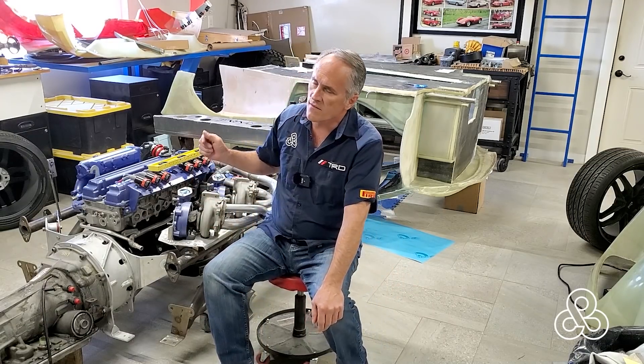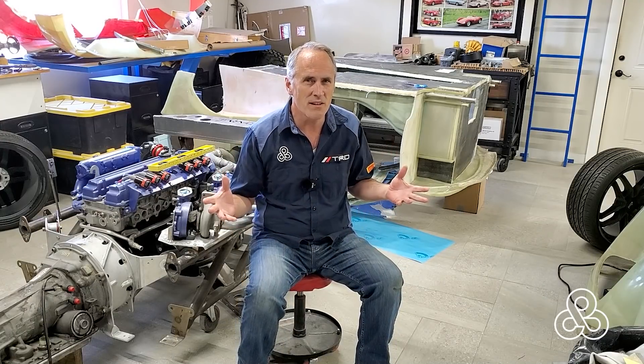We are going to join the front subframe and the rear subframe with the water cooling pipes. They will be running at the lower end of the bottom side of the tunnel. Instead of just putting those in there with clamps, I've decided to put them in with a kind of eight-point connection system so that it connects the subframes. That way I can work on the subframe, engine components, and drivetrain all as an independent unit, even though the tub will be the thing that joins those permanently, at least fully structural-wise. In the meantime, we're going to have them connected so we can work on them and maybe even run without the tub in place.